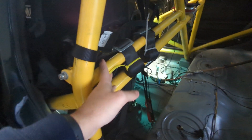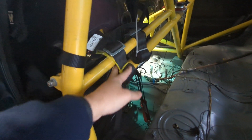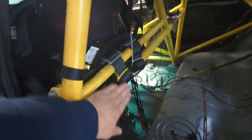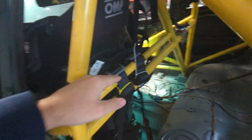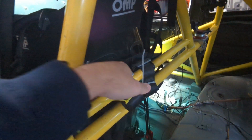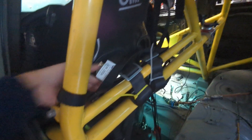You can see I have a smaller bar for my harness, and that allows the proper angle going into the seats. If your seat is too close to your harness bar, you may have an extreme angle going up. The way you want your harnesses to mount to your cage is so that when they go through the seat they're pulling down on your shoulder, not down on the seat. You can see these go down when they go through the hole and never contact the seat when strapped against me.